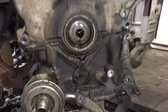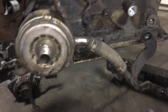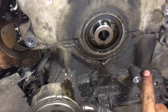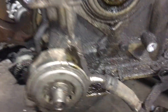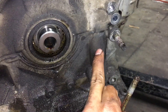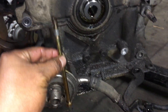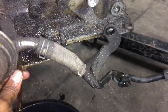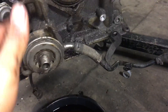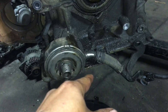The reason for this video is that you do have to take the oil pan out. On each side, you can see there are two long bolts — there's one long and one short. This short one goes from here into there, so these two bolts are holding the timing cover from down below. It's kind of hard to see them because you need the opening clear in order to get to those two bolts.